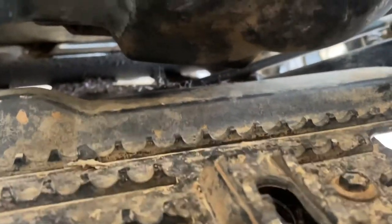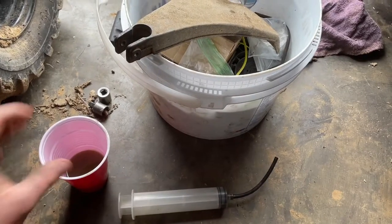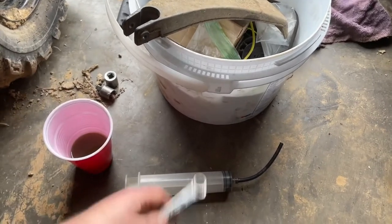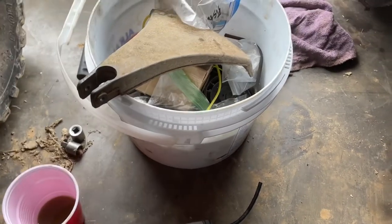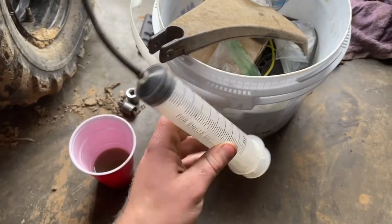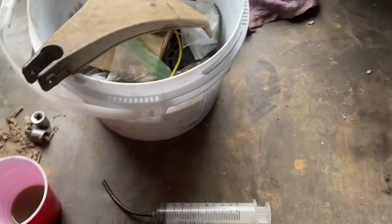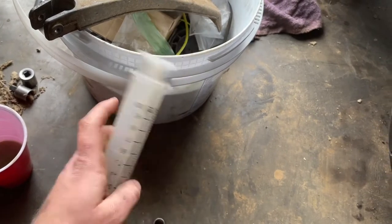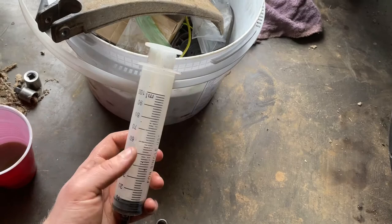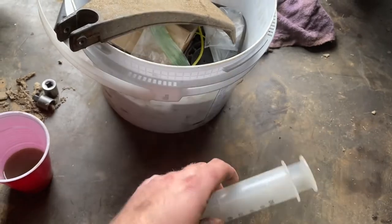All you need is a 12 millimeter bolt right in here. Tools needed: a red solo cup, a 12 millimeter wrench or socket, and one of these 100 milliliter syringes with some weed eater gas line stubbed on the end. Or you could go to Dollar Tree or Dollar General — they have these things called flavor injectors, meant to shoot cheese into a turkey or something, and they're like 30 mil. Get one of those; that works just fine.